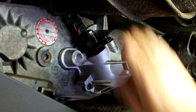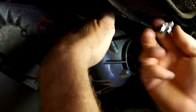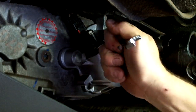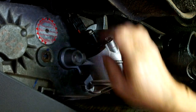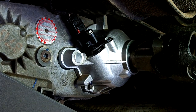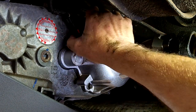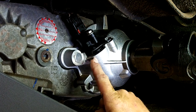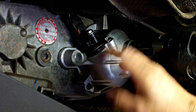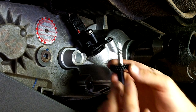Put that back on. You don't have to get crazy with the torque here — it's just the O-ring and there's hardly any pressure on this at all. I don't know how many foot-pounds that is, but it ain't a whole lot. And that should work great for you. Just remember, you've got to use whatever gear tooth you need, rotate this so it lines up with this part of the piece of metal, and that meshes the gear that's on the output shaft with the teeth of this, so it'll operate.